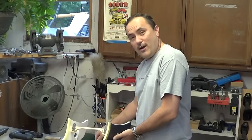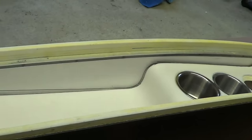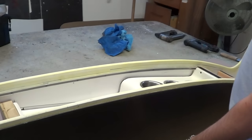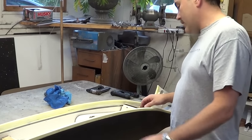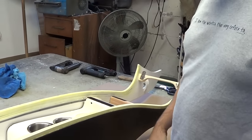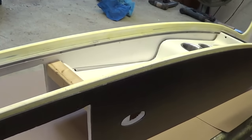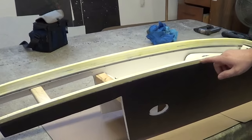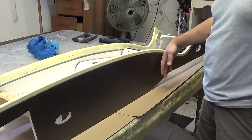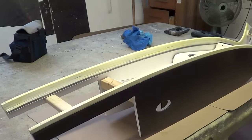Four days later — Tim, how's that console coming? We're still waiting on leather for a day. We finished up the seat so we had enough to start cutting some for the sides. I still don't have leather for the centerpiece, but I've got enough for the door and the dash piece — got that covered a while ago. This black stuff you put on here — this is an eighth-inch PVC sheet I put on there to give a sculpting line and mainly to cover the screws for the little blocks so it keeps it all smooth. Then you spray it with vinyl top adhesive, put it on there and let it tack up real good.